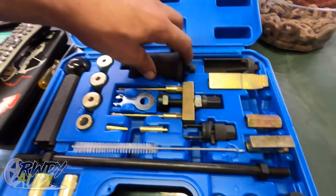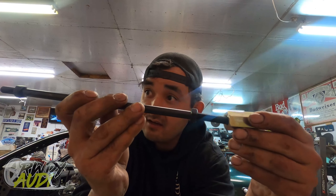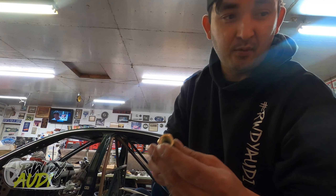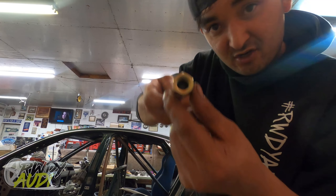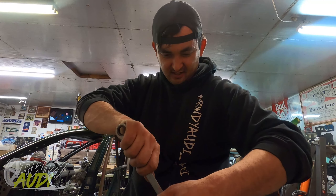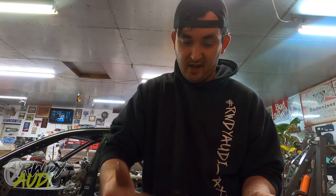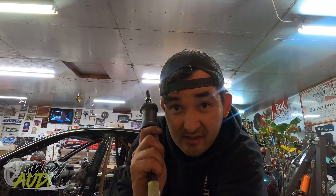We need this piece right here, this piece right here, and that piece right there. So essentially this piece goes in here — there are two different length ends, take the short of the two ends and run it down inside of there to something like that. I have it at the end of the shaft at the highest point. Tighten that up just a little bit — get a wrench there. I got a seven-eighths on this thing and a 16 on the inside nut. Snug those two up. On the other end, take your nut off, take your slide hammer — run your nut all the way down. You don't want to tighten this one because you don't want to mess up the threads. Now you've got a slide hammer — let's go use this thing and see if it's worth the $86 we spent on it.